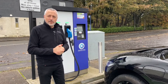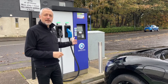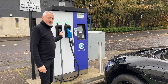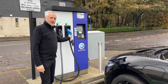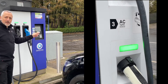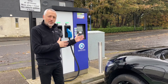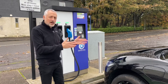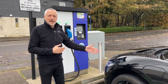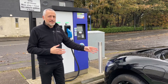The first thing you need to know is what type of connector you want to use. If you want a rapid charge — in this case a 50 kilowatt charger — you need to use the rapid charger cable. This charger has a CCS DC rapid charger cable, a CHAdeMO rapid charger, and around the other side an AC rapid charger up to 43 kilowatts. Don't get confused with that one — it only works on the Renault Zoe, older models. In most cases, cars can't take an AC rapid charge because it's the onboard charger that determines the speed. In my case I've got a 7 kilowatt onboard charger, so the maximum I'd get is 7 kilowatts — I want to use the CCS connector.